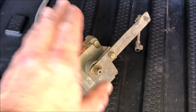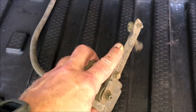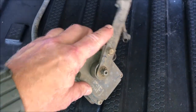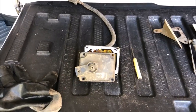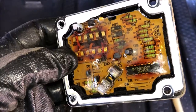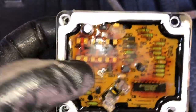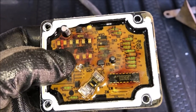While I'm trying to find a suitable wiring diagram for this level sensor I'm going to take it apart. What I've been able to determine is that the articulation of the arm up and down completes the ground to the relay, and that's what tells the compressor to turn on or the exhaust to open depending on which direction it moves. I've taken it apart, removed all the screws, and taken the cap off. You can see this is a potted circuit — immersed in plastic to protect it from moisture. There's some discoloration on the board; the only way to truly test it may be to put it on a Cadillac and articulate it to see if the compressor or exhaust activates.